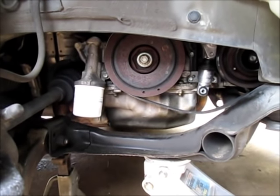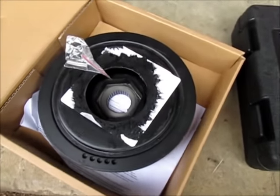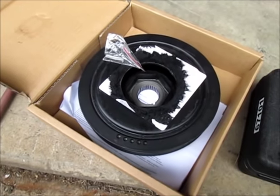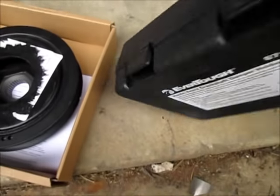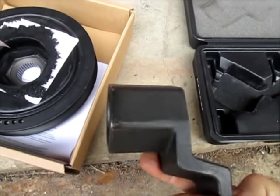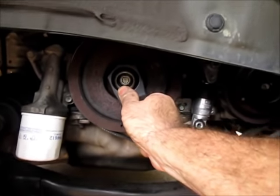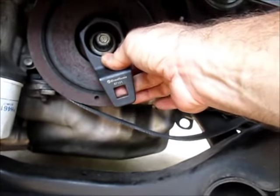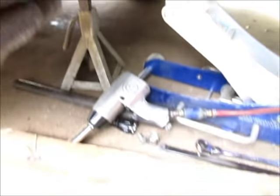My impact won't break that loose, so I had to come up with something else. I did go to Advanced and picked up a new balancer — I think it was $129. Nice guys that they are, they didn't have the rental tool I needed, so they directed me to O'Reilly's. Here they have it: Ever Tough 67101. That's the tool — I guess you'd call it an exterior hex — so that's going to fit inside of that recess there. Then I can put a bar through that hole, hold it in place, and put a secondary breaker bar on the bolt itself.